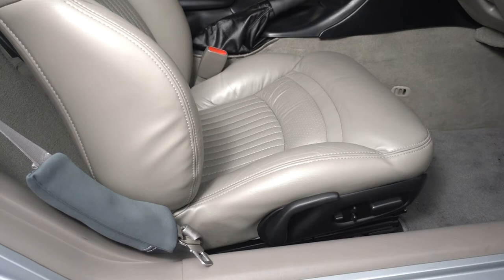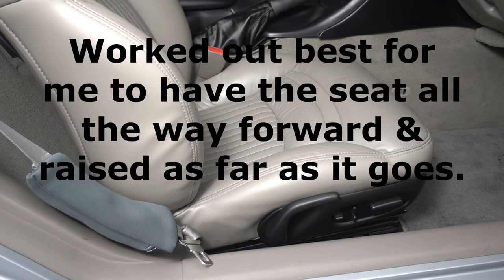The first thing I'm going to do is remove the targa top to facilitate the removal of the seat. I'm going to start with the passenger seat. I'm going to use the motor to raise the seat as high as it'll go. Then I'll move the seat forward to get the rear bolts — there are two bolts in the rear. Then I'll move the seat back to get the front bolts. I need to do some research on whether it's advantageous to end with the seat to the rear or the front.